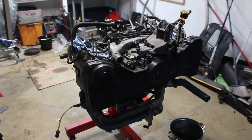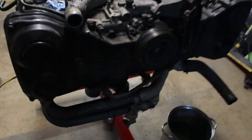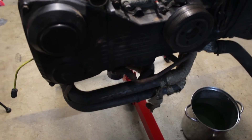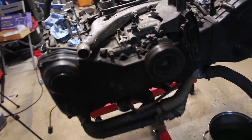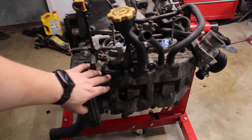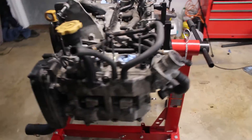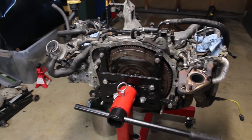Taking a look around the engine, it was not in great shape. The exhaust wrap was totally falling apart, the oil cooler lines were all rusty, there are some leaks here and there, coolant lines are pretty brittle, and the oil fill tube is leaking. It's not in horrible shape, but it'll need a fair amount of reconditioning. Now that the engine's out, it's time to tear it down. Thanks for watching — feel free to like and subscribe, and stay tuned for the next video where I tear the engine down.